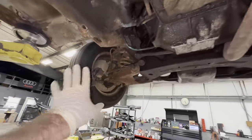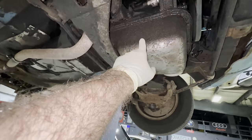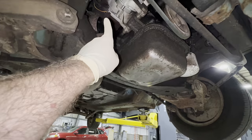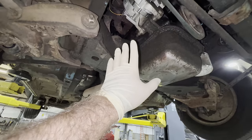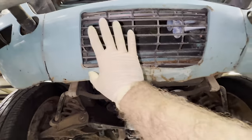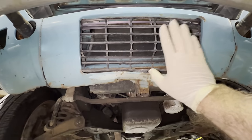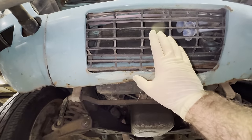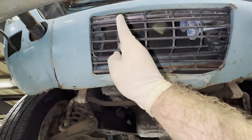Beyond servicing the car with fresh fluids, brakes, and so on, we need to modify a few things. One is the oil pan — we're going to add a drain bung for the turbo oil return back to the pan. We'll obviously need an oil feed going into the turbo as well. For coolant lines to the turbo, I'm not 100% sure yet — we might have to skip it and find another way to keep the turbo cool. Over here there's also this big opening where I'm thinking about mounting the intercooler internally so it stays hidden.